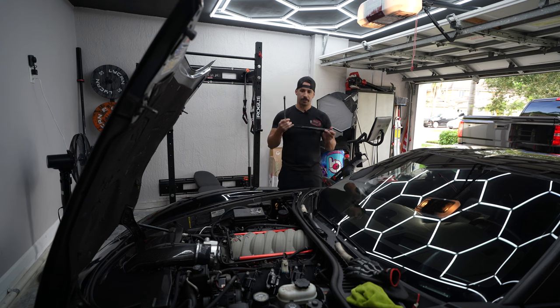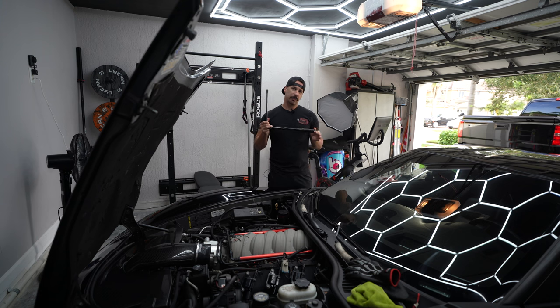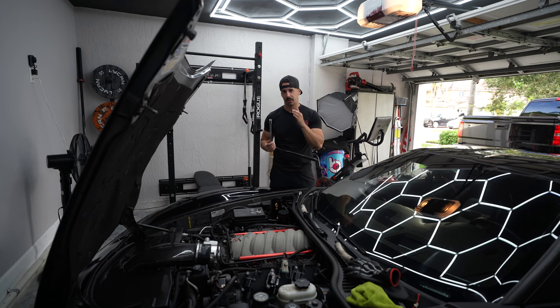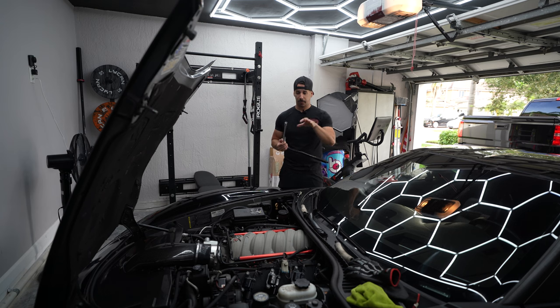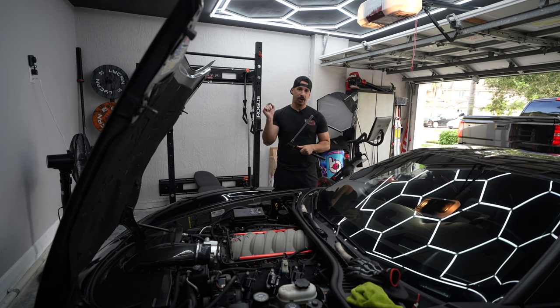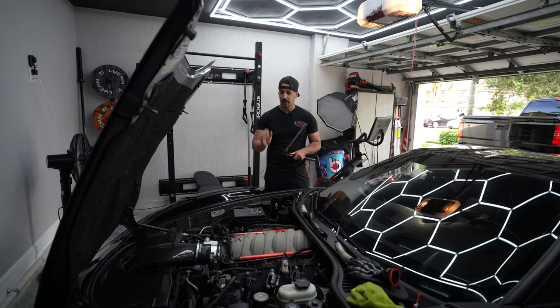I decided to grab my torque wrench and look at the bolt right there next to where the standing water is. I set my torque wrench at about 22 pounds, which is very, very low for any head bolt. I proceed to see if it'll click immediately, letting me know I'm at pressure. I was able to do a little less than a quarter turn before my torque wrench clicked at 22 pounds. This leads me to believe that my shop rushed to finish this car and did not properly torque down certain head bolts. So the goal for today is to pull the valve covers off on both sides and run through every single head bolt.